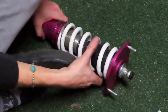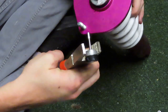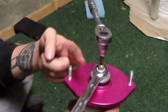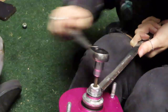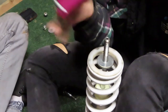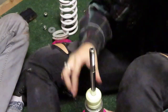And that's the easy way to get a Miata coil out. Once you have the coil out of the car, for these coils you need to take the dampening knob off. We're going to use some pliers to unscrew it, and then you'll have access to the locking nut, just like that. Next, you're going to take a 19mm wrench for the nut on the top hat, and then I'm using a T30 — or a six-point star bit. You want to ratchet this nut off of the top hat. So then you take your top hat off and there will be a little plastic sleeve, a washer right where this ring is, your spring, another thing, and then your bump stop.